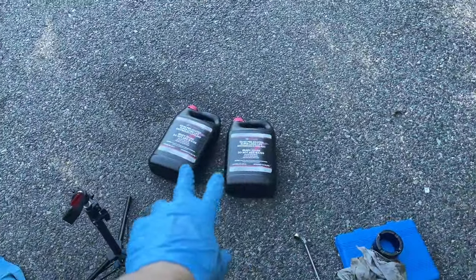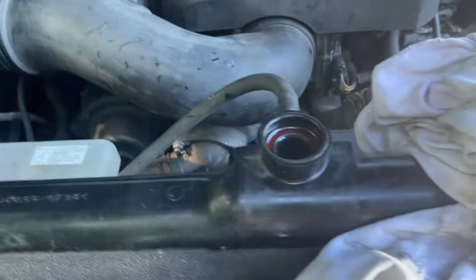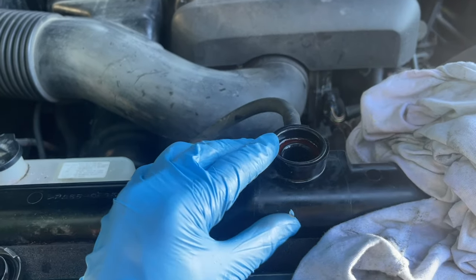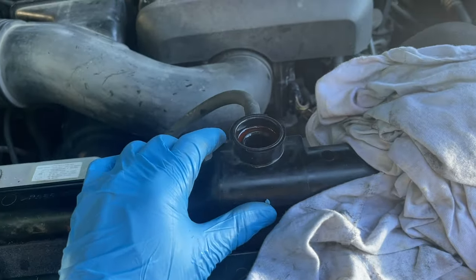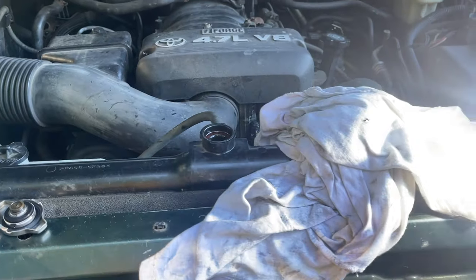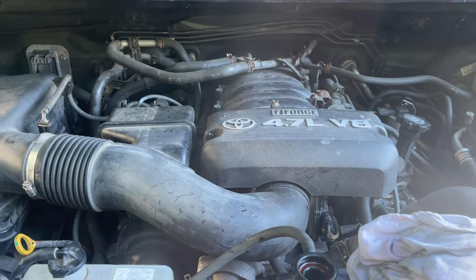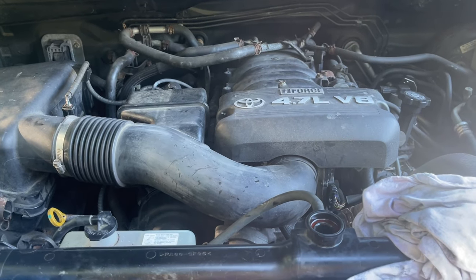The way I bleed is I fill up with two of the one gallon Toyota OEM 50-50 pre-diluted coolant. Just throw it all in there. I'm just going to turn over the engine and let it run through and get all the air out, and then drive around for a little bit. If I need to add more, I'll add more. But that's how I let the air out. I don't know if it's the correct way to bleed it, so comment below if it is. I'm not saying I'm doing it the correct way. I'm just doing it in the driveway, some guy trying to help you save money on the internet.